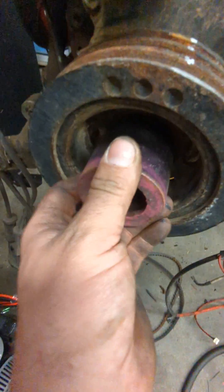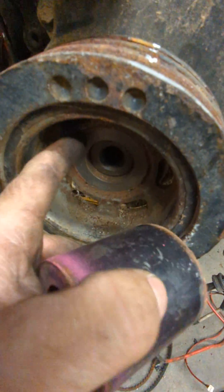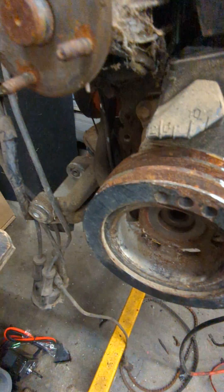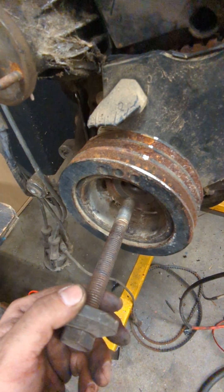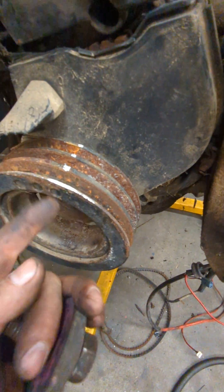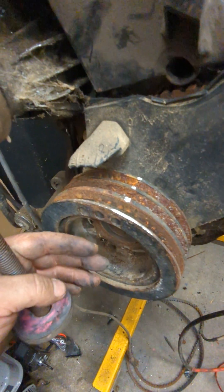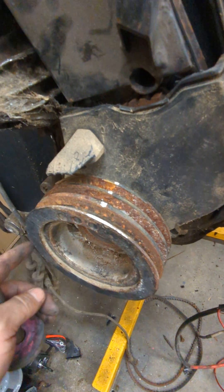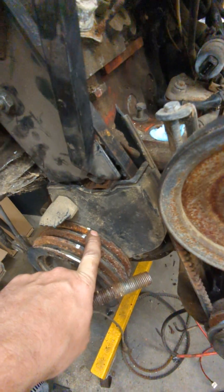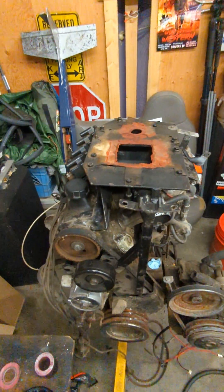I've got a spacer that sits in the shoulder — this lip's OD is right about that ID so it's centered and doesn't wobble. That takes up the space so when you run a longer bolt through the power steering pump pulley it grabs on there. We machined this a little bit less than the depth so it pinches and gets driven by this surface. I never had this slip, but I had lots of the timing gear shear off. That is how I did it — feel free to copy me.